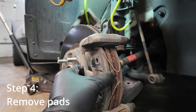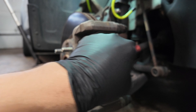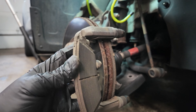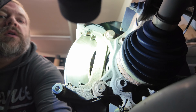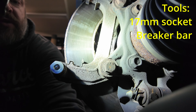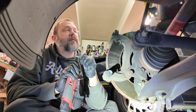We've exposed the brake pads and the caliper bracket. Now it's time to pull off our pads — we'll start by removing the springs, and the pads themselves should just come right out. You can see it's definitely time. On the back of the rotor there are two 17 millimeter bolts using a 17 millimeter swivel impact socket.